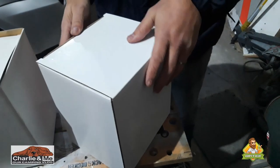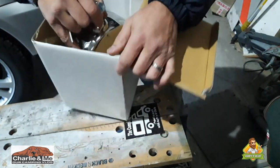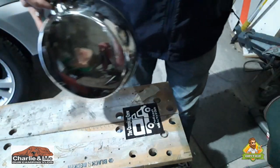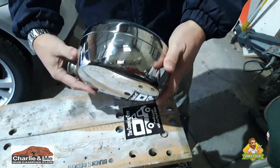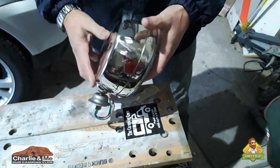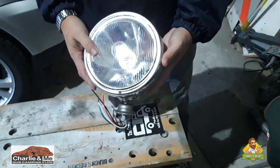Let me show you the spotlights I got — these are absolutely fantastic. I'd begrudge fitting them onto this jeep because I'll be selling it; I'd much rather fit them onto the Hymer or even the ambulance. But oh my god, they are going to make the front look brilliant. I've found it very hard to get spotlights over the past couple of weeks because guys in auto accessory shops are saying that modern cars are so electronic — you flick on spotlights and the ECU throws a fault for drawing too much voltage. So these are going on a separate switch. They're chrome, none of your plastic stuff.